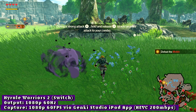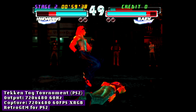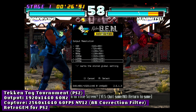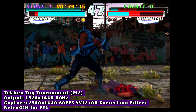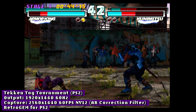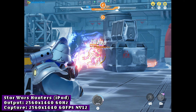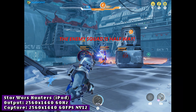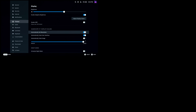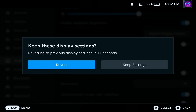In terms of my normal oddball capture testing, the device supports native 720x480 capture from retro HDMI systems in full 4:4:4 XRGB, which is wonderful for scaling. It supports the 1920x1440 mode from the Retro Gem scaler for the PS2 just fine, though it interprets it as 2560x1440 and will need an aspect ratio correction filter to fix it in OBS, as usual for these cards. It supports the native 1440p screen mirror from my iPad Pro or 4K external monitor mode, which is handy. It also cooperates great with my Steam Deck in all resolutions, though there isn't a native 1280x800 mode, so you'll need an aspect ratio filter to fix that too.